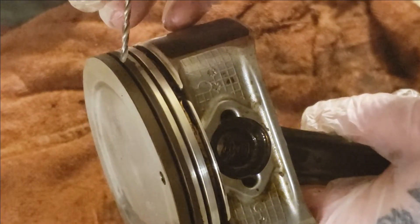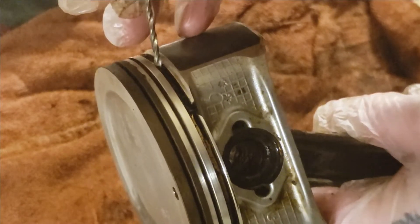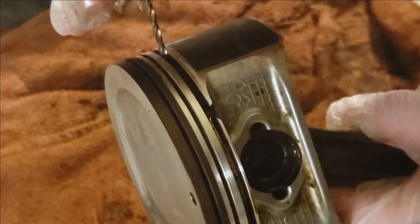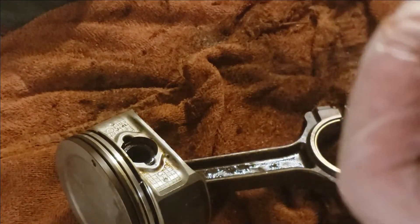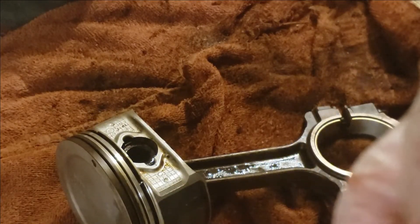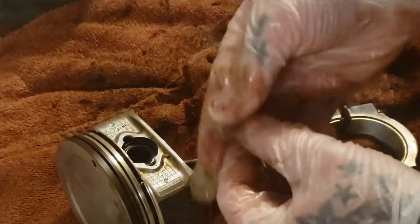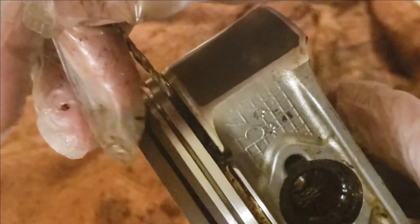You do not want to drill here or here. You want a drill bit that will fit inside here with a little bit of movement and not really touch the sides. But if you touch the side a little bit it's fine, it ain't going to be the end of the world. As these are flanged you can see a taper in. Just make sure you ain't got no burr or anything that will catch your ring after your drill. The size of this drill bit — I don't have the top for my drill bit set — so just get a couple and try them. It's pretty small.